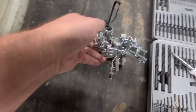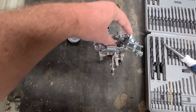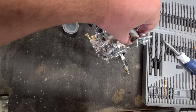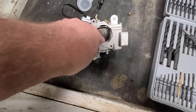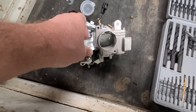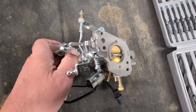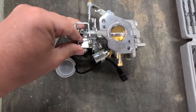Maybe they do run them a little on the lean side, which would be my guess. One thing I have to mention is that this has a mechanical choke — you see it has a little idle up when you put the choke on. It opens that throttle a little bit. It's also spring-loaded a little bit, so if you run it with the choke on your revved up, it doesn't totally kill the motor. It's got an idle up cam built on.